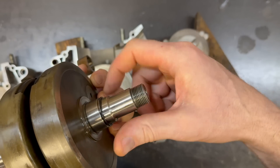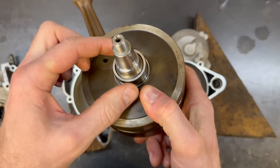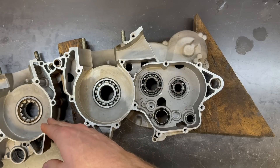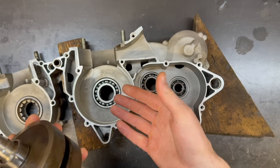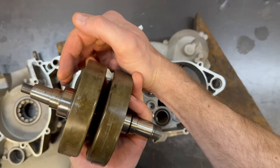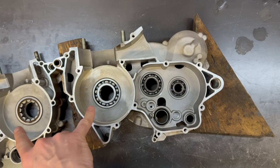The reason that's important is because since this is a slip fit, it's possible for the crank to spin inside the inner race of the bearing, and when that happens, this gets superheated and it gets welded to the crank bearing. With the stock system, the left side crank bearing is interference fit. What often happens is people drop the crankshaft into the left case half. In order to do that, you either have to pull it in or use heat, and then the crank bearing is locked onto the shaft. Then they put this nut on and it pulls the crank over, which then takes this inner race — which is stuck to the crank — and pulls it over, but the outer race is stuck inside this case half, so then you have side loading. The inner race is pulled in relative to the outer race. It's my theory that that's why these crank bearings fail.